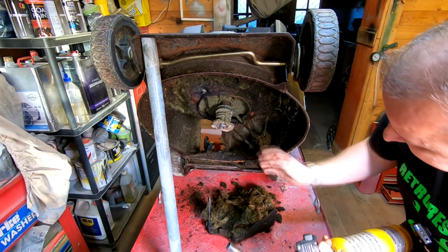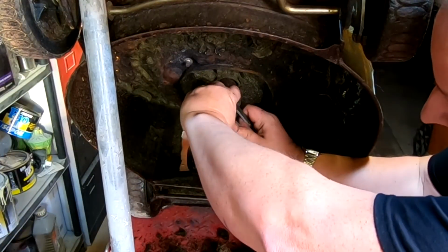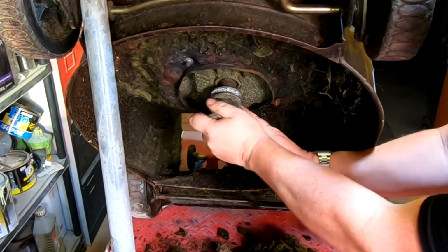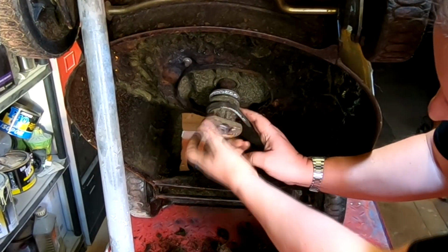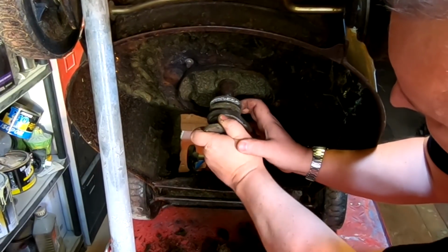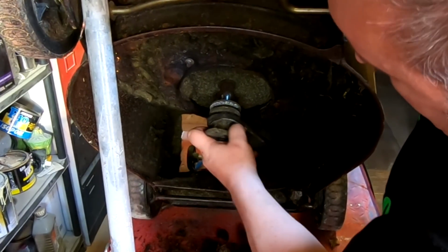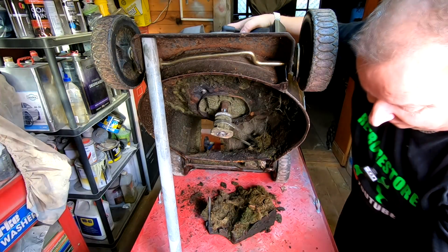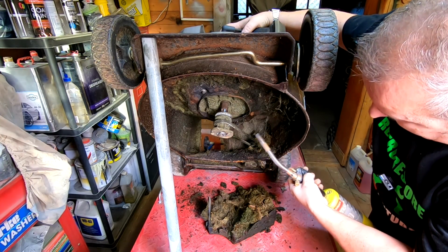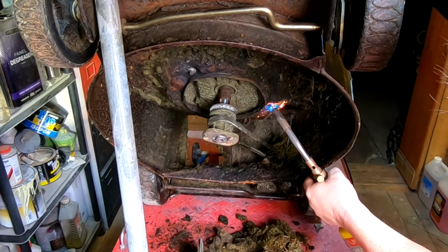Right, now I've got that off, if I take that belt off, I don't want to burn the belt, you see, so let's pull that belt down a bit further. Hold on. In fact, that should come off now, that boss should come off. And I'm lucky because it's nice and slidey, look. Here we go, come on boss. It's probably just enough out of the way there, so let's just try and heat that bolt up a bit. So I want to use that belt again, hopefully, so I don't want to burn it. Sometimes heat's the only way to get these tight, stubborn bolts out, you see.